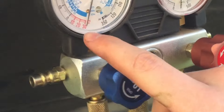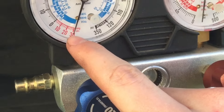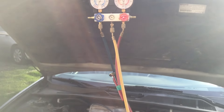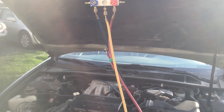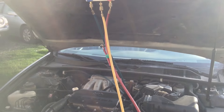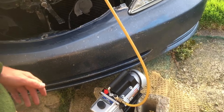We'll let this run for a little bit. Typically it'll sit just right at or a little bit below 30 inches of mercury. This step is important because what we're doing is fully evacuating the system of any moisture and air that's in there, and moisture is what can really damage your AC system. The longer you can let the pump run, the better — I'll probably let this go for maybe an hour. You don't need to go all day.